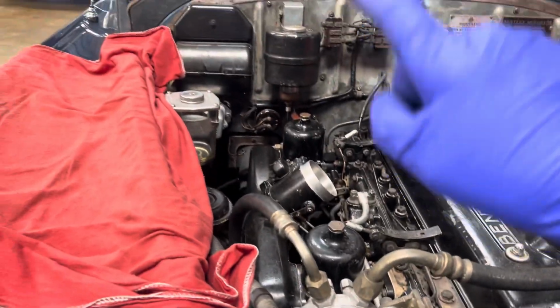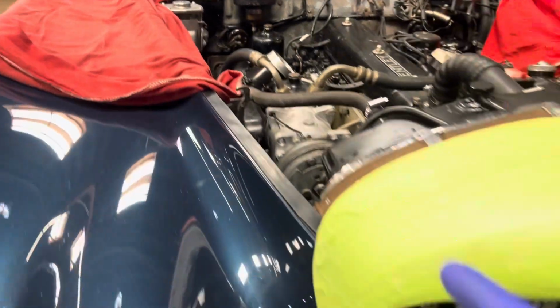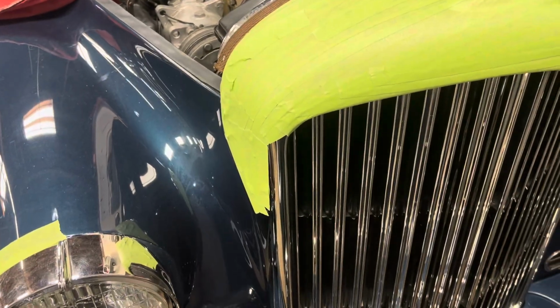And there's a front and rear system. So the person did this right for a nice vehicle like this, for what they had available back in the day. Do I have light? Yeah, I got light. So they do have the 3/8 inch tube and fin. It's not the densest fin count. We're probably at 12 fins. I don't think I'll be able to measure 14 fins per inch.